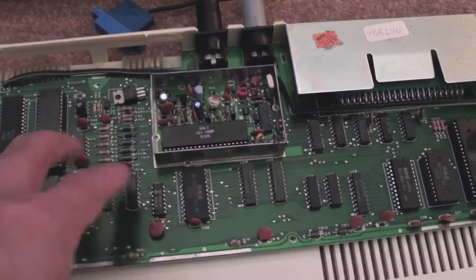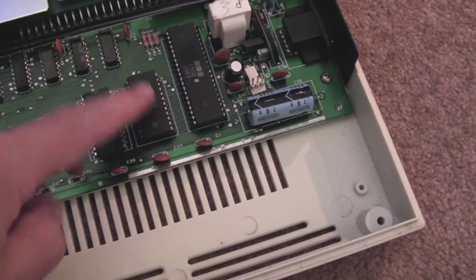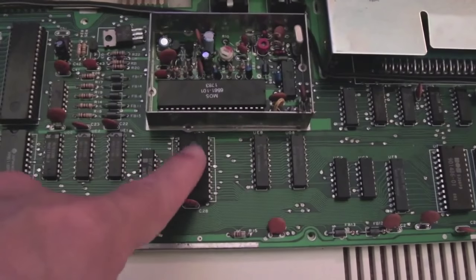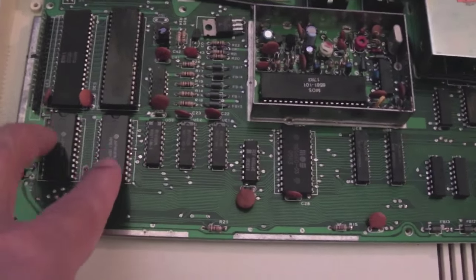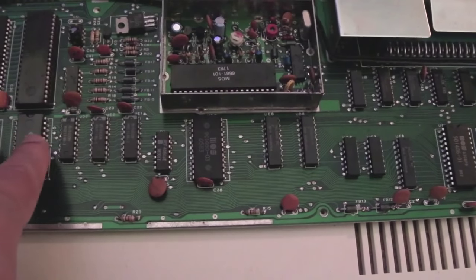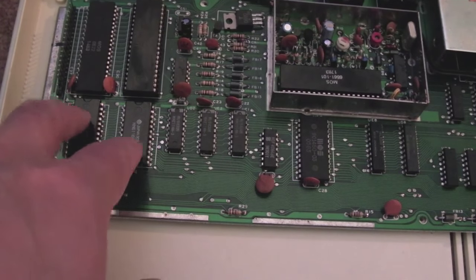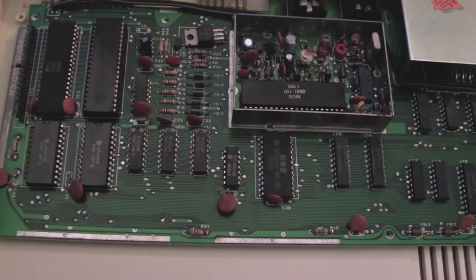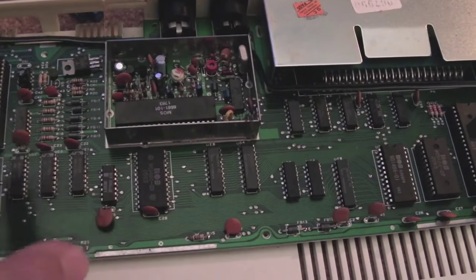I'll show a few things while we're here. I think that's the kernel ROM — nine times out of ten a black screen will be the kernel ROM. I think that's the basic ROM, and you've got a character ROM used by the VIC chip. Then you've got three of these 2114 RAM chips and two RAM chips here. There's very little RAM in these — I read somewhere it's something like 5K, which is an unusual amount. If these are 2K each that gives you 4K — I need to check, I've not really looked into the specs too much. It's very similar in layout to the Commodore 64.